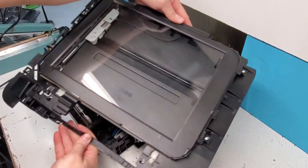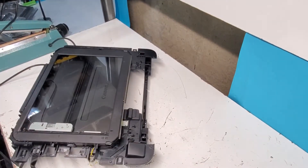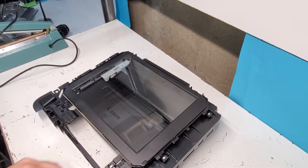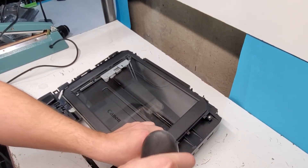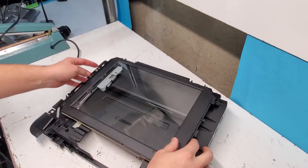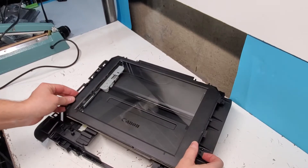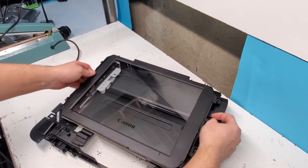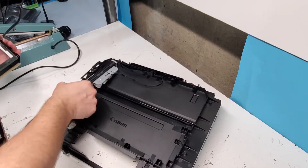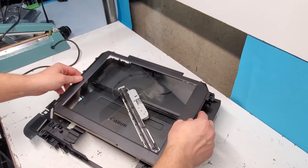That's the top cover. I'll show you how to get into the scanner unit if you want to replace it. To get into the scanner, you're going to remove the two screws, then slide it over — there are tabs on this side that need to be lifted and this needs to be pushed to the right side. There we go, that releases it, and there you have it — that's where the scanner unit is. If you're trying to replace it, that's where to find it.